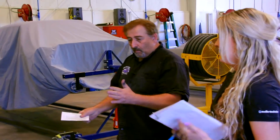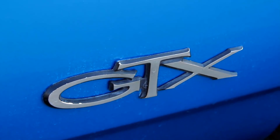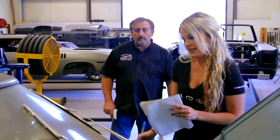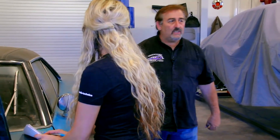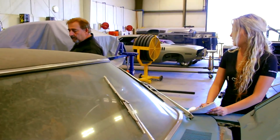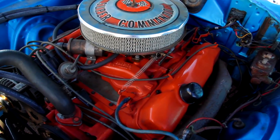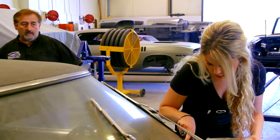What's the next two digits? 2, 3 — that means it's a two-door hardtop, meaning the back windows and the front windows both roll down. A 21 is a post where the back windows don't roll down but the front ones do. What's the fifth digit? L — that's a 375 horsepower Super Commando 440. Sixth character? Nine — that's the year of the car. What year is it? 69. So write down your notes: 1969.